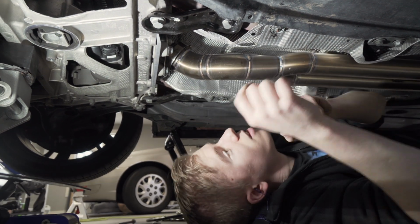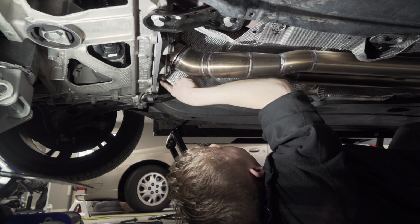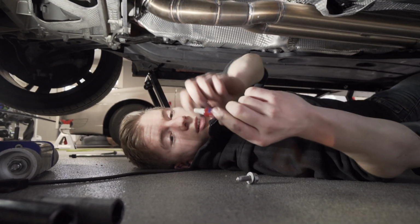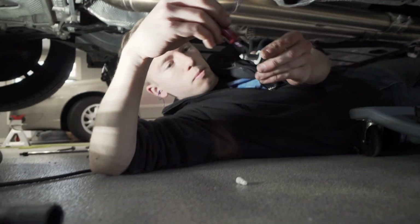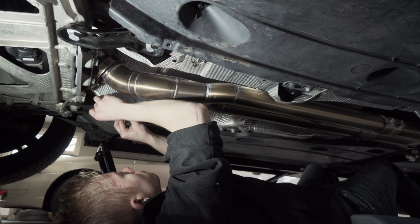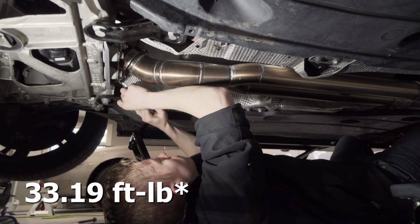a year ago. And the marker is kind of, I see one spot here, but I think I see that spot. In installing those rear 16 mil bolts, is this supposed to be red Loctite? That is blue Loctite you have in your hand. But yes, it's supposed to be blue Loctite on those short 16 mil bolts on the rear of the subframe brackets, these black pieces. Those are torqued to 45 Newton meters, which I'm gonna quick do a conversion.